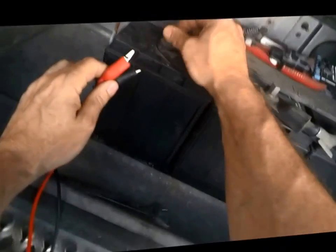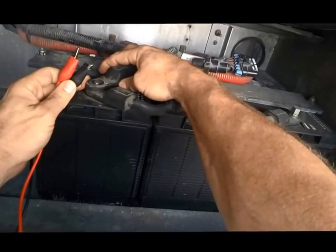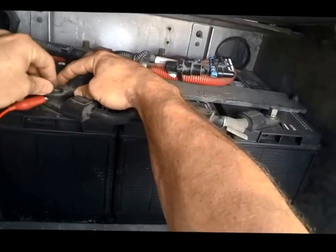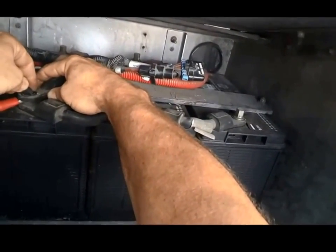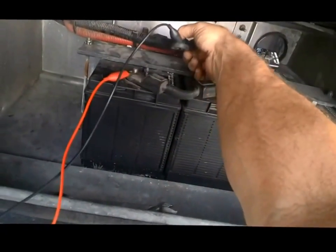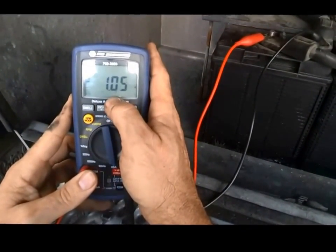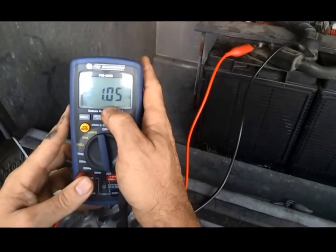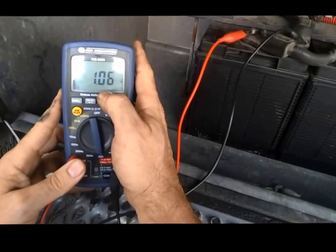I'm going to do it without the special service tool. I'm going to keep a little pressure on this post, get up underneath it, put a positive post in there and rock this up just a little bit, then pull it off to the side. Now I'm in series with the meter and the meter is pulling one amp right now. We've got one amp — that's unacceptable — but we've got to wait about 10 minutes. Once we do that, we'll find out if it falls down to an acceptable amount.